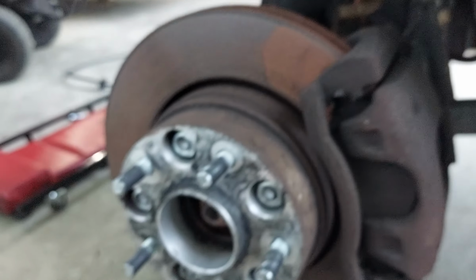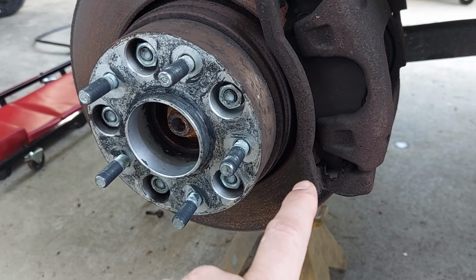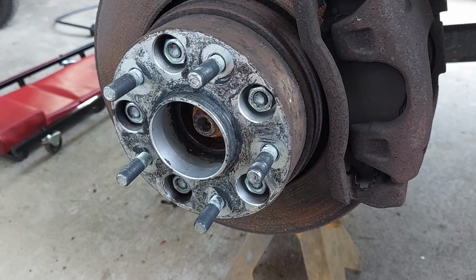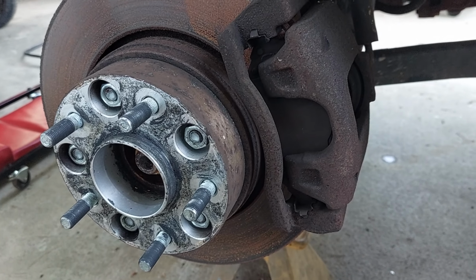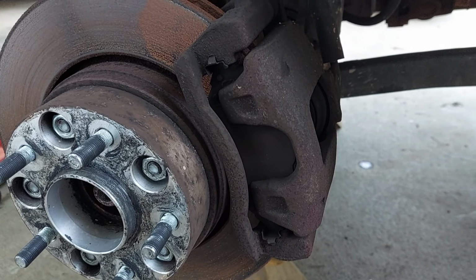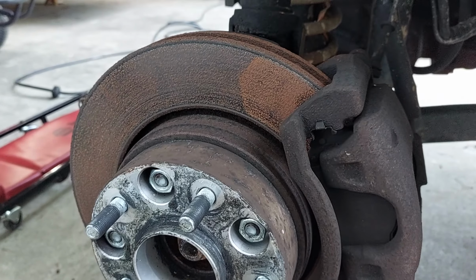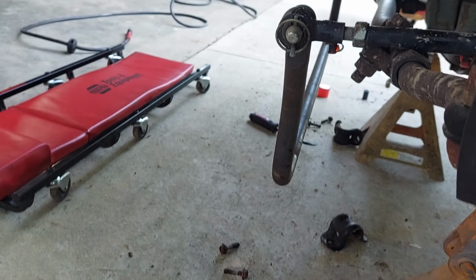These brake pads are still good. I'm hoping this is it. This one did it to me a handful of years ago, and it was this caliper, and you could smell it. You could get out, touch the rim. The rim was significantly hotter than any of the other ones. And it ended up being a lubrication issue. I took everything out, re-lubricated all the parts, cleaned them up, put it all back together. And it's been 3 years, just about. So if that's all it is, that's all it is. That'll be great. But back to the bar.